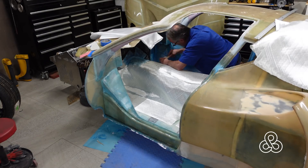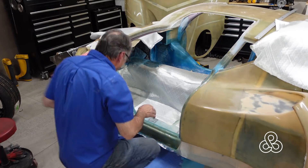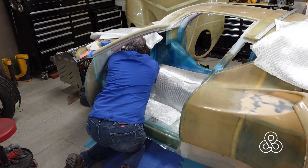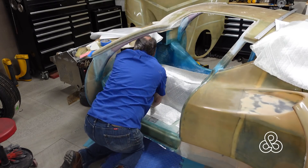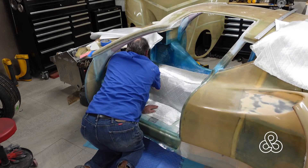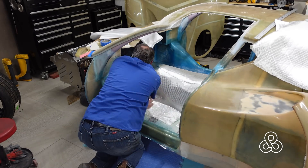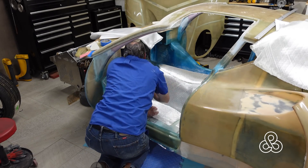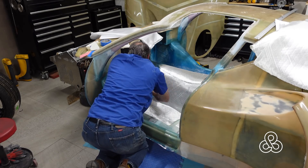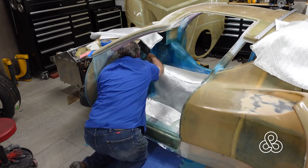The area that seems so ridiculously wide is where the tunnel attaches to the rear bulkhead — it's way behind the seats anyway. There'll be a secondary bulkhead forming the seat back and a compartment for electronics and climate controls. Typically this is where the fuel cell is in many mid-engine cars, but most of those have rear-mounted transaxles. I chose not to put the fuel cell here as the transmission would split the tank in two and it takes up too much space. When we get the final layers on the tunnel interior it'll be close to ready for a hard surface for painting or upholstery — let me know in the comments which direction you think I should go.